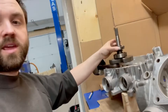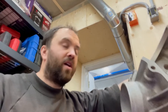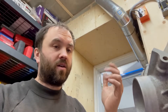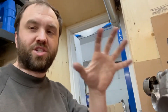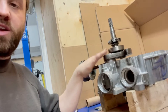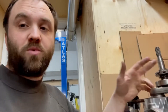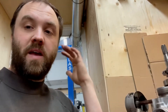It's a good mod to do if you have your motor apart. I'm also building a puller to pull the crank into the assembly. A lot of guys just hammer it in but I don't want that because I don't want the bearings being pounded. I'm using 3-inch black iron pipe, 1.25-inch tube, and a power steering puller welded in with an M10 x 1.25 nut in the middle - thread it in and it'll pull the crank into the casing instead of pushing it in. I read about a guy who froze the crank, heated the case, rushed it all the way in, started bolting the case together - these cranks are pressed together - and he started creating side load, bent the crank, it seized, and he had to remove the crank, re-time it, and put it all back in. Total waste of time.